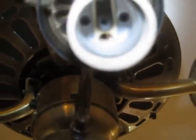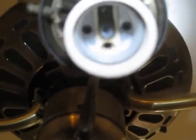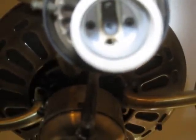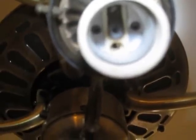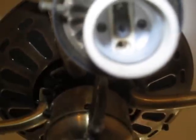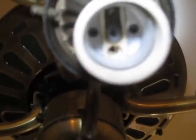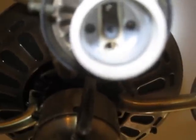The third way is if the hot tab coming down from the top here becomes brittle, broken, or bent, or corroded — in all ways that the contact is compromised at the hot tab. Over-tightening light bulbs will do that, and sometimes you can just bend it back upward, or toward the camera in this case, to restore the spring tension as you install the next lamp.